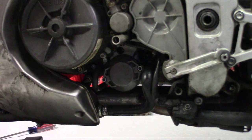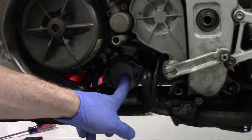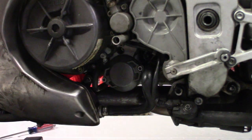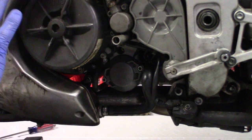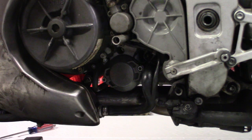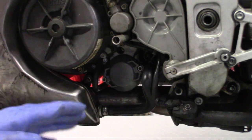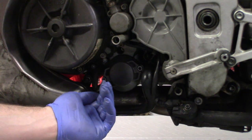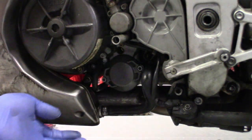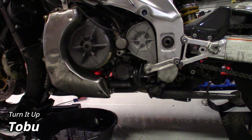When we go to replace the oil filter, I'm also a stickler about replacing these o-ring gaskets on the oil filter. Do you really want to risk an oil filter leak over an o-ring seal that costs a dollar? Every time I change the oil I replace that o-ring. People cut corners and don't replace it thinking it's never leaked before — but if it leaks and puts fifty or sixty dollars of oil on your bike you're going to be upset. I'll go in, loosen these bolts, let the excess drain out, then take the cover off and pull the oil filter. I always use an oil pan and look how much oil comes out, then replace as needed.